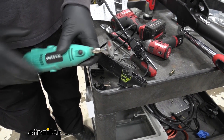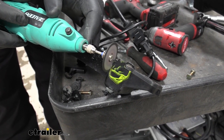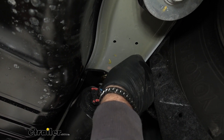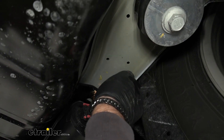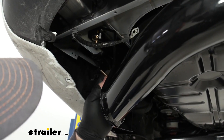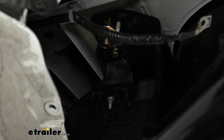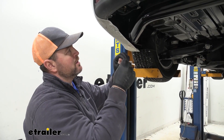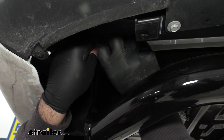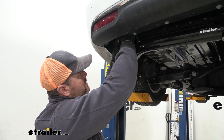I'm going to use a rotary tool with a plastic cutting blade to trim this out. Now that we've got it trimmed out, we can take our factory bolt and put it back into place in the front hole — the one closest to the tire. For our back hole, the kit comes with a longer bolt; we'll use that one right here. There's also a small bolt and nut in your kit — we're going to take the ground wire and attach it right here. Then take an 11 millimeter socket and wrench and tighten the nut and bolt down.